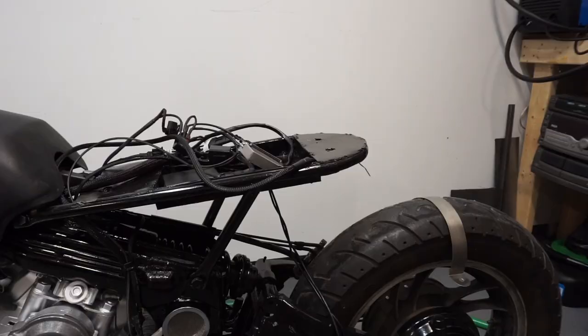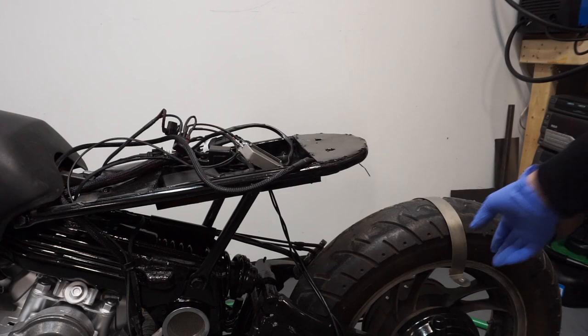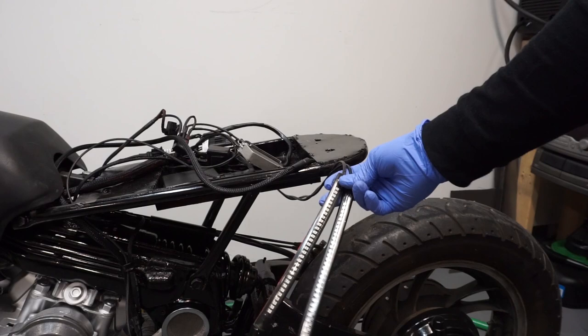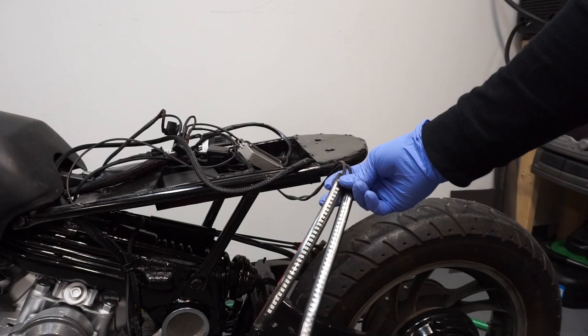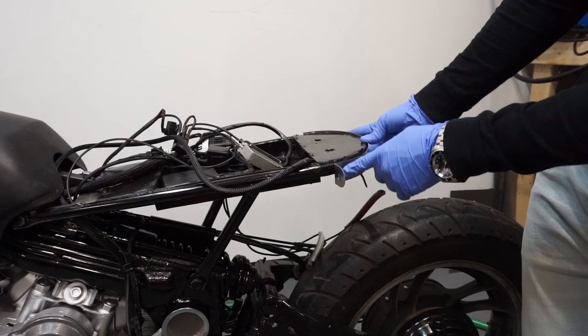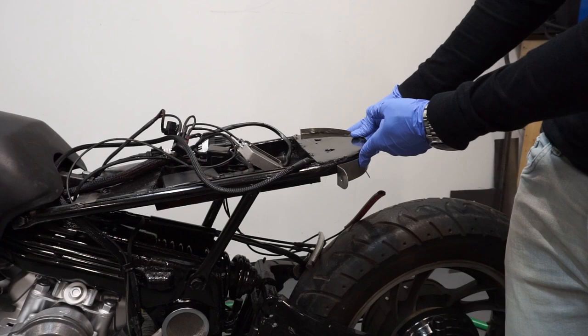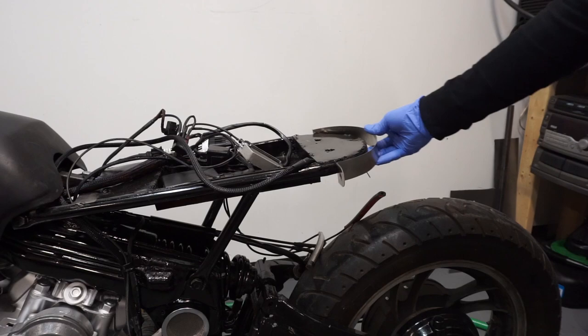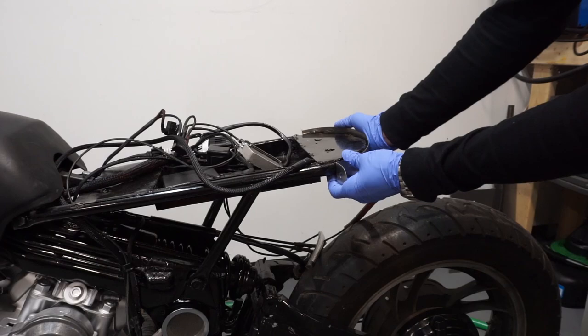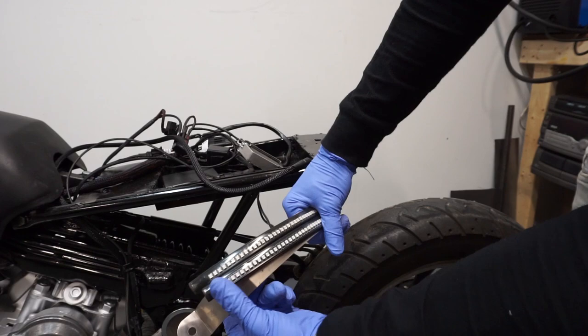So for the rear taillights — I have a dedicated taillight and one that's a signal light with brake light. The taillight also turns on as a brake light, but when you had both hooked up it was very dim; you didn't really see the brake light go on. So I obviously want this to be safe. I'm going to hook them up at the back of the frame. I have this piece of stainless steel that I'm thinking of welding onto the frame. It'll need a little modification — I want to cut these tabs off. I think this came off the exhaust from my Honda Grom. It actually works out perfectly. These are held on with some 3M tape, and then this piece will be welded to the subframe.